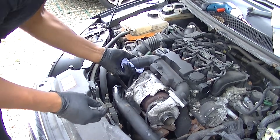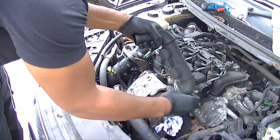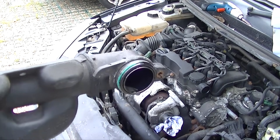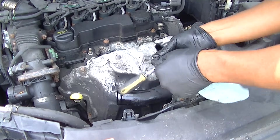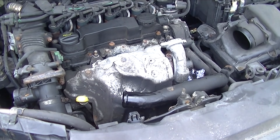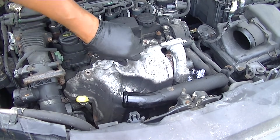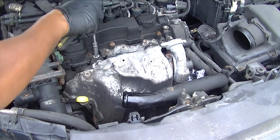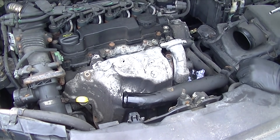This part here — just twist it up and it comes off. There is a bolt that holds it but this one didn't have the bolt. It's got a little hook on the left and a bolt hole on the right. This is the turbo heat shield — it's a 10mm socket. Take your time undoing it; the casing can become brittle and break. There's also a 6mm bolt at the top because it has an overlapping shield, so you need to undo both.